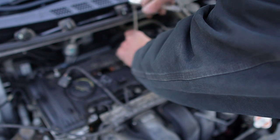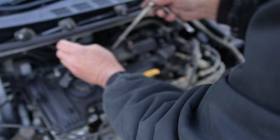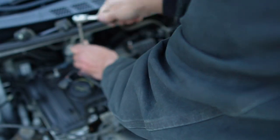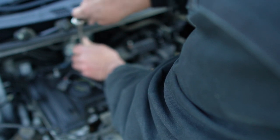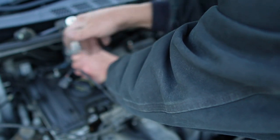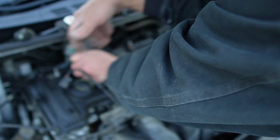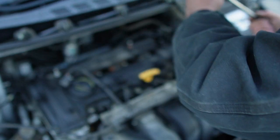It's not a good sign that it was loose, but in our case, it's probably a good sign, because that is leading us to believe that we may just have a blown valve cover gasket. And it's a whole lot easier of a fix than changing the engine out, which is going to be probably our next step if this isn't the problem.